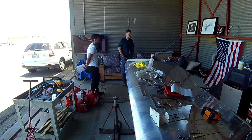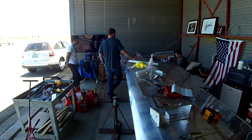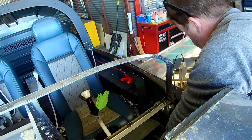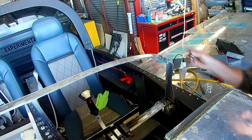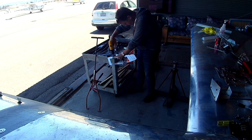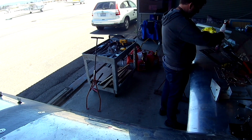I've had the whole panel cut in 5052 aluminum and the whole thing cost $100, and I think maybe $120 for shipping. It was still trial and error though, as you'll see in a bit. I'm using breaker switches for all the lights up front because I don't have enough room on the circuit breaker panel for the strobes and all that. Problem is those things are one and a half inches across, so you can't place them where all those nut plates are at the bottom where the panel attaches. So I did have to have the left panel cut a couple of times, but it has worked out great — you'll see that in the next video.